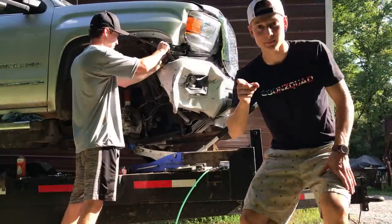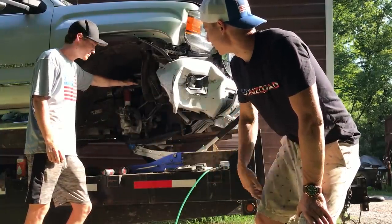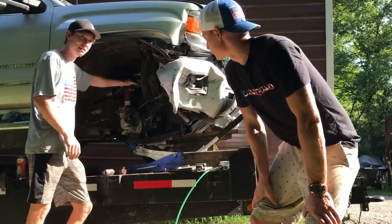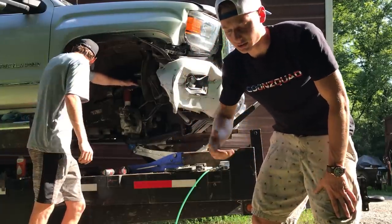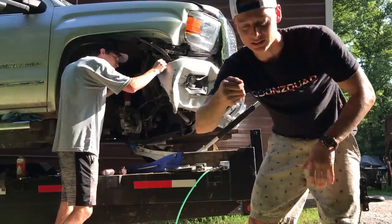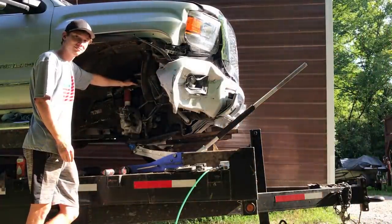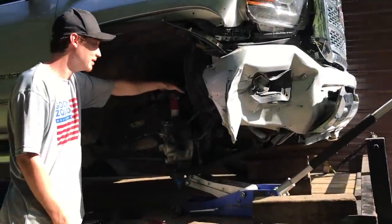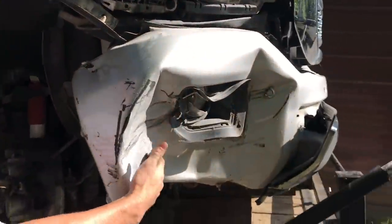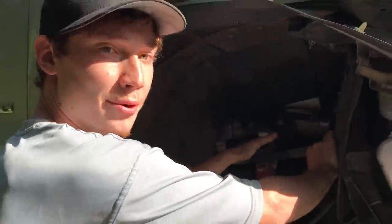That's one thing I hate about Ford — that little slipping it does and you've got to walk outside and lock the hubs. Hopefully this truck won't have that. It doesn't have an axle up front — it's independent suspension, it's got a differential up there. It probably locks itself. Because we got the wheels on and the cap covers the locking thing, so all that riffraff you've got to go through on the Ford — anyway, we pulled it out a good bit. Hopefully the wheel will fit. If it doesn't, I'm honestly just going to take a grinder and cut half of this bumper off. Now we can get to this upper control arm bolt.